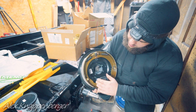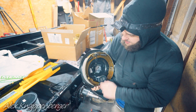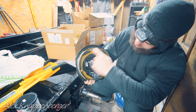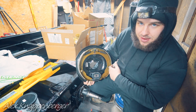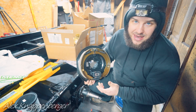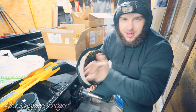This arm goes in the front. This is the left side, the driver's side of the trailer, and this arm will be facing forward. When the hub is turning, the magnet energizes and gets pulled back, which pushes out the brake shoes. In reverse it kind of works the other way but not as well. So the arm that the electric magnet is attached to always has to be facing forward.